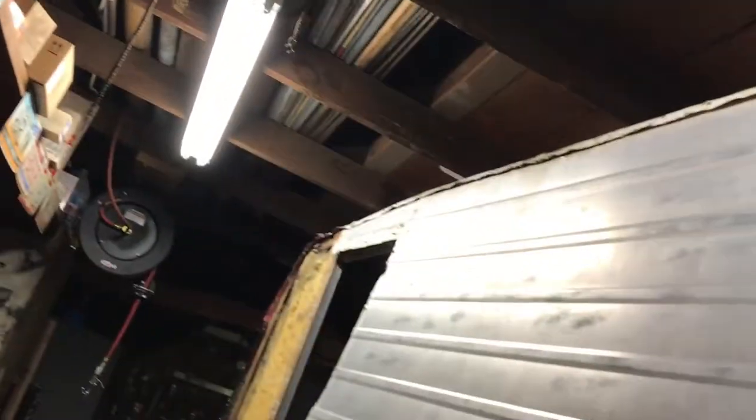See? So this roof has to come off first, and I managed to spend like 3 hours, probably 2 hours, getting that seam open after getting the original aluminum L-channel and the windows out, but you gotta be real gentle. But man, there's staples everywhere. There's all staples down here, and once the staples come out there, then this is a separate piece, okay? So take that piece off. And then I continue with the roof, and even all along that window, it's full of staples.